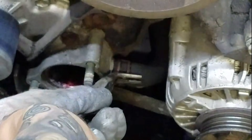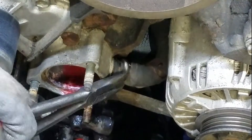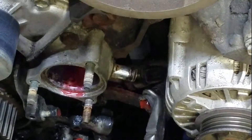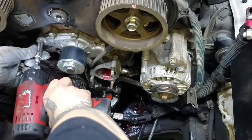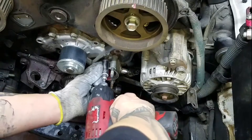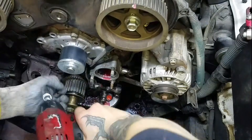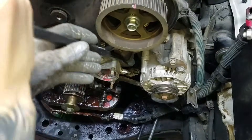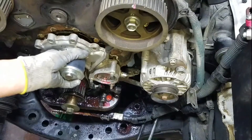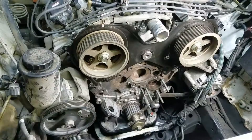Now I'm going to remove the hose clamp from my bypass tube — the bypass tube I was talking about earlier, make sure you order the right water pump. I love these pliers, these are like one of my favorites. I love the Toyota long life red coolant too, it looks like it's bleeding. You do not have to remove this in a star pattern — I sometimes get obsessive about stupid things, but I'm removing it in a star pattern, whatever. 12 millimeters again and all these bolts are the same length, so set them aside in a magnetic tray. Someone put a little too much sealant on this so I'm prying gently from a couple safe locations on either side. You can see this old water pump used the paper gasket and sealant. Look what we got here — everything's off.